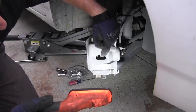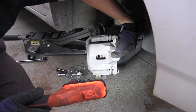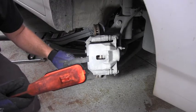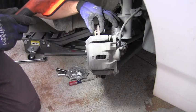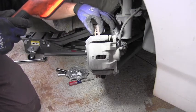So I can see through this opening that the inner brake pad has the same thickness as the outer pad. Also I can measure the minimum thickness of the rotor right here, so this is another inspection point.